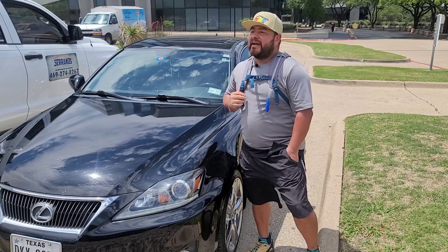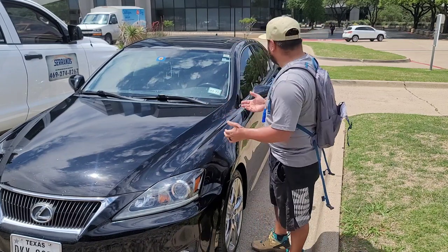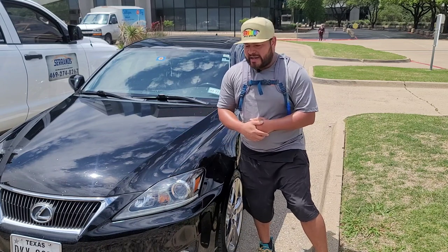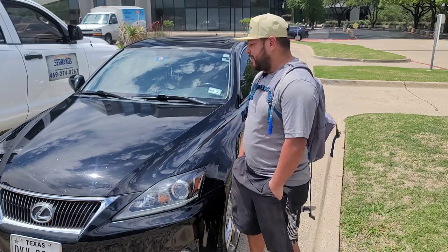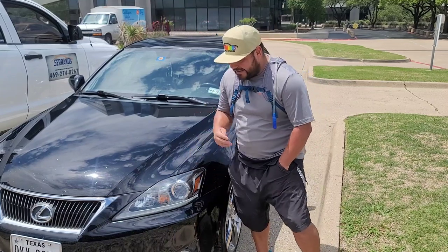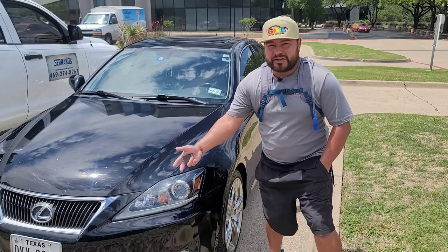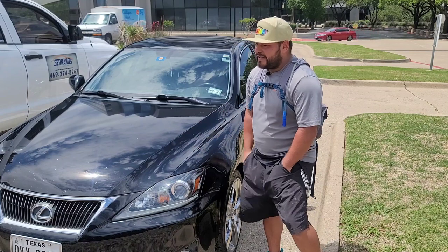It is hot out here, but I hope today's video showed you guys how I restore headlights. This is really showing you how I do it right, and you can take or leave the steps. You don't always have to start at an aggressive sandpaper — you can usually start around 1500 up to 3000 and be all right. But given the scenario these lights were in, I had to really get in there and move a lot of that rust and oxidation. The main goal of headlight restoration is restoring the headlight to a new-looking finish, and that is truly what we achieved.